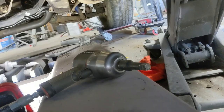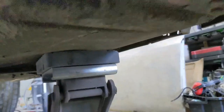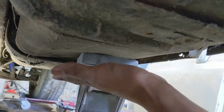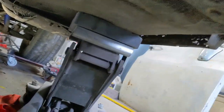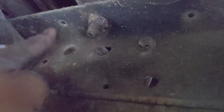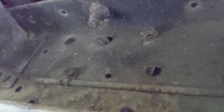I'm down here underneath the truck. I went ahead and jacked up the fuel tank where it was already dented, so no harm there. If you don't have a dented fuel tank, take a two-by-four running between this brace and that brace and you can lift up the whole tank at once. Up here on the inside of the frame at the back mount, there are four nine-sixteenths bolts - two on this side and two over there. Same setup at the front strap - four more bolts inside the frame - so eight total.